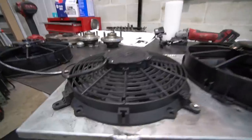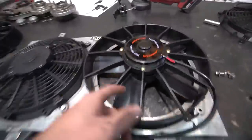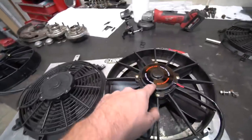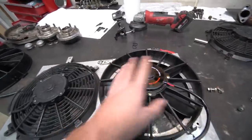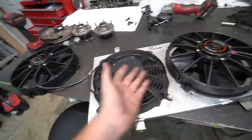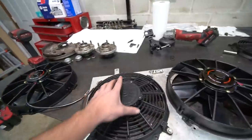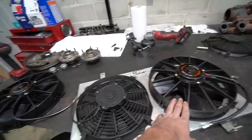You can see how big of a difference it is between your basic slim fan and a Mishimoto race fan. These race fans are wild — they pull so much air. I have a pair of these smaller ones, like 10 or 11 inch, on the LS Miata and the car never gets hot. It's just based on the design — you look at the pitch of the blades, how much more aggressive it is on these versus these, and the size of the blades. No matter what, one of these slim fans is not going to pull as much air as one of these, so if you can fit a bigger fan, do it.